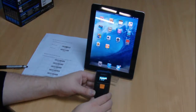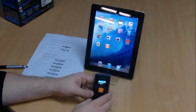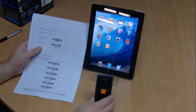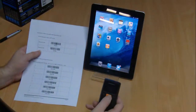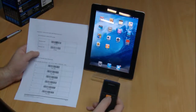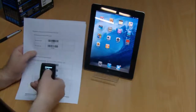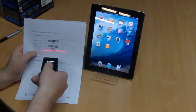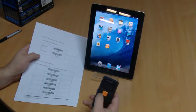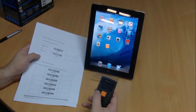What we're now ready to do is choose the Bluetooth mode for the device. This is the first step where you'll need your BI500 setup sheets that you downloaded earlier. All we have to do is set up the HID mode, which is the Bluetooth mode required for Apple devices. Just select the center button and choose scan barcode. On your setup sheets, just scan the Bluetooth HID barcode. As soon as you do this the device will power down again as it has set up the HID mode for Bluetooth for the BI500.